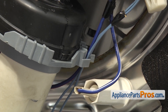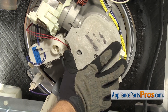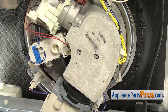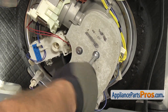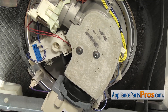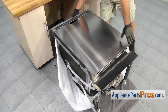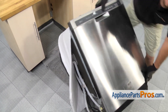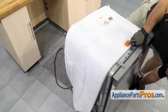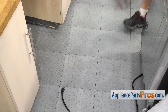Once you have the wires secure, we can put the counterweight back on. All you have to do is line it up, set it in place, and use the 5/16 inch nut driver to put the screws in. Now that we have the dishwasher back together, we can put it back up on its feet. Carefully lift it up — the insulation may be sliding off, so make sure you grab that at the same time. Now pull the towel out and push the dishwasher back into the cabinet.